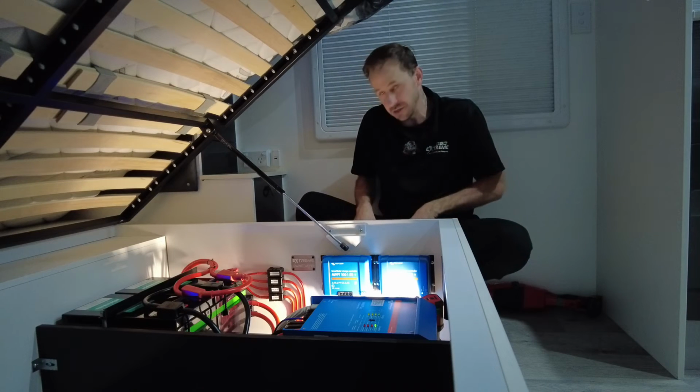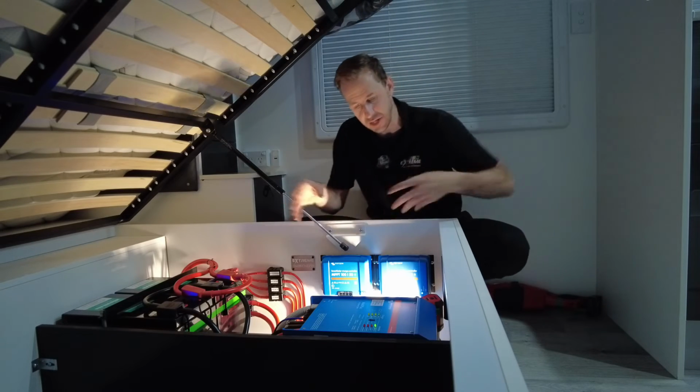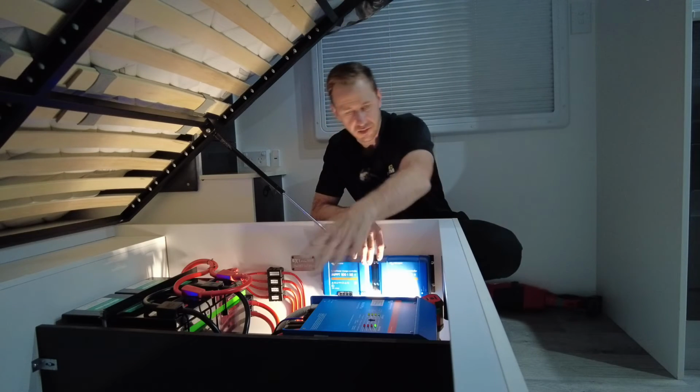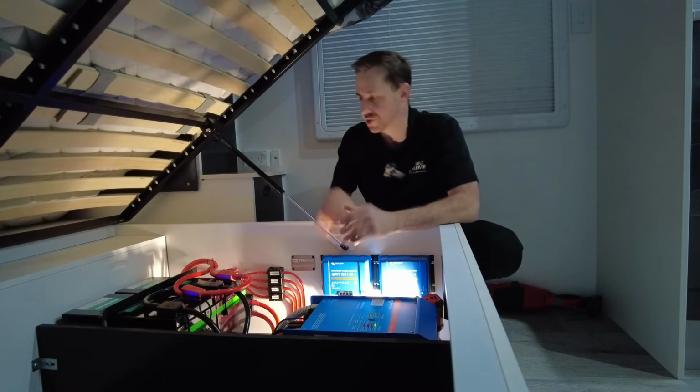We're able to do the venting right behind the solar controllers in this one. Most of the jobs we can't. We have to put vents in other places, but we're able to get them right behind each solar controller. So we're happy days with that one. Nice and open here. Plenty of space around it. Got 120 mil odd there. More on this side. And it's all secure down, ready to go.